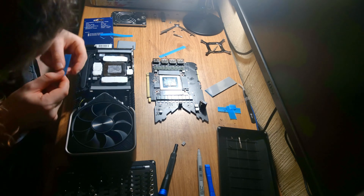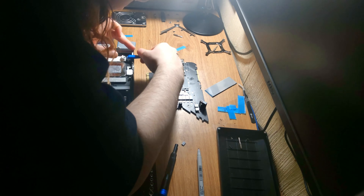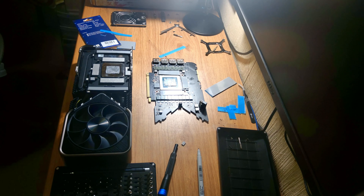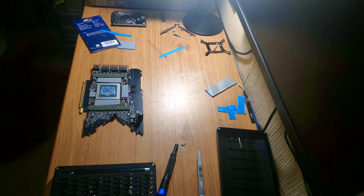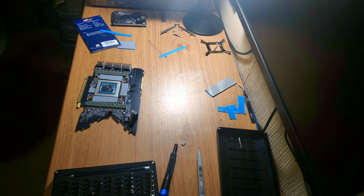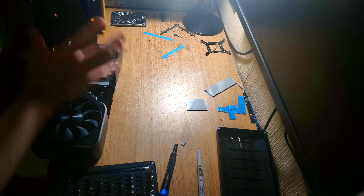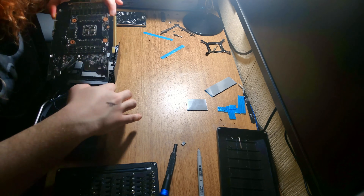You can mark up how big you need for each piece, then simply line it up with either the cooler itself, or place it directly on the memory since that works out a bit easier. When you sandwich it all together, it'll press and line up nicely, and then you check if everything is fitting well enough. If not, pull off the pads that don't realign. If they're too big or too small, make another pad, or cut it in half and use the smaller piece to save some material.